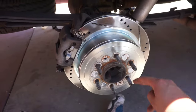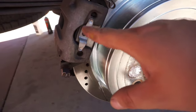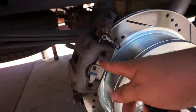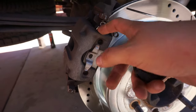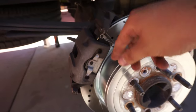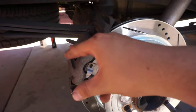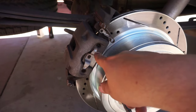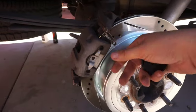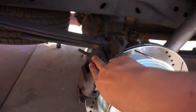All right, so we're here at the back side. As I mentioned, the rotors are brand new, so those are at least nice and clean. This is what I meant earlier — this clip here. If they didn't have these clips, I could probably just mask it and spray it. But seeing that it has these clips, I'm probably just gonna take off the caliper and take off this pad, then hang it or put it back without the pad, and then mask behind the caliper and spray it. I'm definitely taking off this brake pad because of these clips.